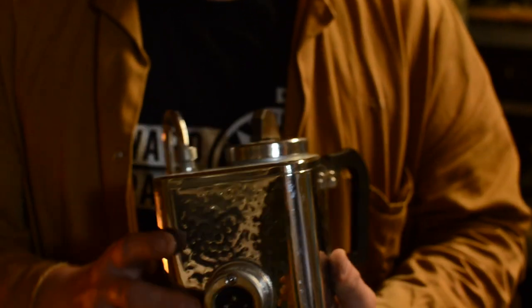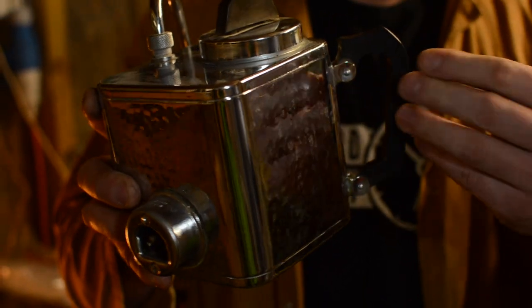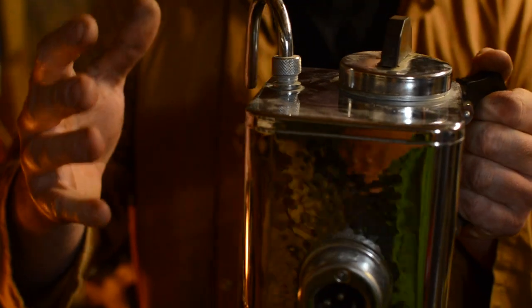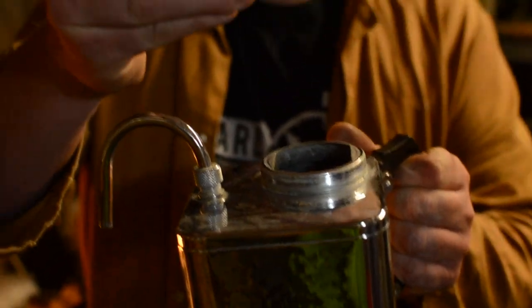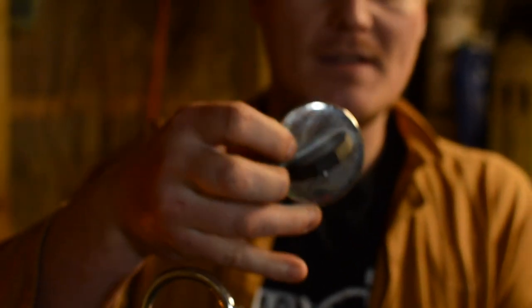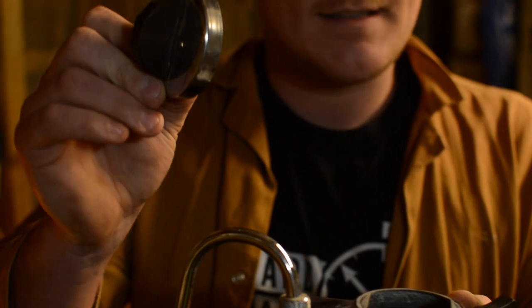Before I put the Teasmade back together and actually use it, we'll just have a look at the kettle and the teapot itself. The kettle — there's not much to talk about here, but it's worth having a look. There's the power input. The handle is basically out of a material like some kind of plastic which will not conduct the temperature, so it's safe to pick up. The same goes for the cap. Now the big difference between this kettle and a typical one you'd find at home is this one actually pressurises, and that's why the cap here screws down. There's a little pressure relief hole on the top, just so the pressure doesn't build up high enough that the thing can explode. And if you fill it up too much, when it starts to boil, scalding hot water will spray out of that hole like a water pistol, so it's always best never to overfill these things.